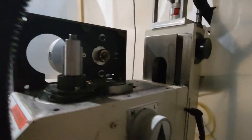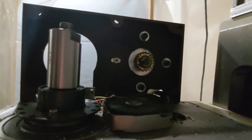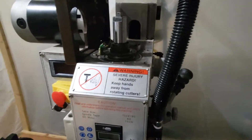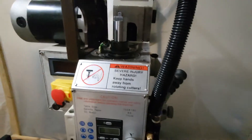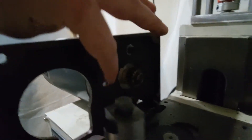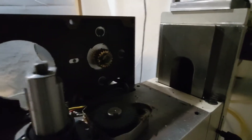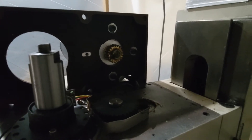I am doing this on the machine, but it's really not four socket head cap screws — just three and a different screw. This is why we upgrade these things. Looking at the photo, you can barely see it, but there's a recess because where that screw is, instead of being on the four corners like the instructions say, it's directly over the gear, so you needed the clearance. That's why you couldn't use a socket head cap screw there. Makes sense, but I hope the hole locations don't interfere with the new mounting bracket — that'll be the first thing I check.